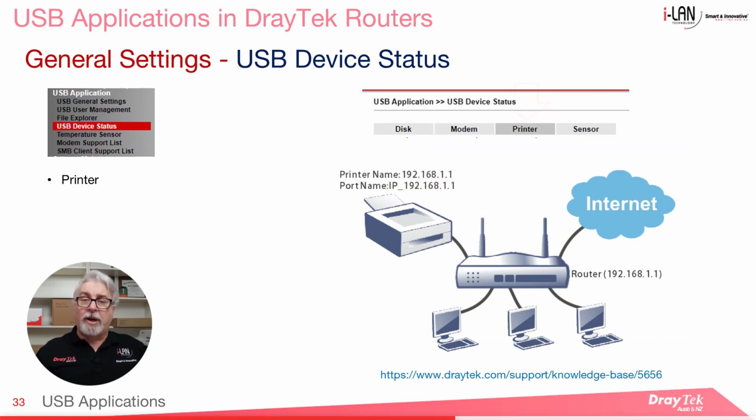Most basic LPR, ink, and laser printers will work fine, but some multi-function printers can be a bit hit and miss. If they do work, you may still not have network access to other functions like the scanner and more advanced printing functions like bidirectional printing, and the printer monitor application probably won't work. Detailed instructions on how to set up LPR printing on a Windows computer is covered in Application Note 5656 in the DrayTek Knowledge Base. That'll be in the description below as well.